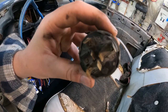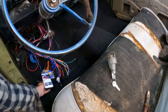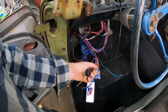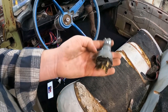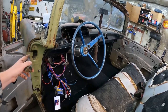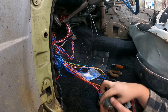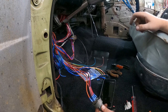What I'm going to do is show you how I'm going to make this ignition switch work, and then hopefully crank it over. I've used this wiring diagram picture off the internet — it just shows you what everything does. These are the two ignition wires — snip the ends off and wherever it says it goes, put a spade on it and hook it up to the key. The big heavy wire is power right from the battery — that's constant power going to the switch. We have our test light — there we go, constant power. These older cars, a lot runs through the ignition switch. These are Tri-Five ignition switches — all the way over to the left it's locked, unlocked you can move it, next one will be start. Grounds are always important.